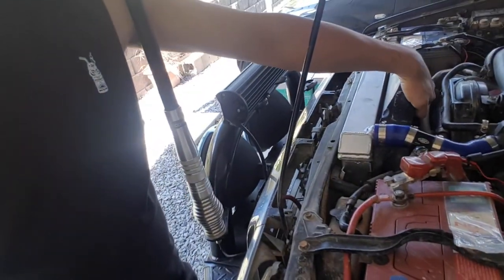The viscous hub fan clutch isn't working very well anymore. I can literally start the engine and grab the fan, and it will just continue to spin. I can hold it while it's spinning, so the clutch is shit. You can repack them with a certain grease you get from Toyota, but I've ended up getting a new one, and I also upgraded the fan to a 10 blade. I think these ones are about 7.